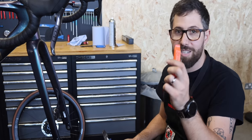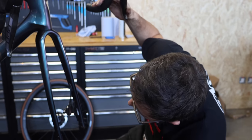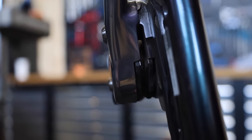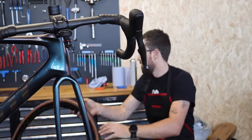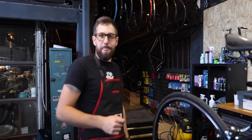This one isn't just for out in the wild — it's for at home too. If you don't want to invest in a dedicated tool, a tire lever works really well — better than a flat screwdriver. Imagine you've been traveling and your brake pads are squeezed too close together to get the disc rotor in. Slowly get it in there and wiggle them back, making sure you do them evenly. Make sure the tire lever is clean before you do it — you don't want any oil or dirt getting onto your brake pads. Some multi-tools also have pad spreaders built in, which do the same job.